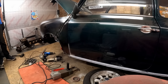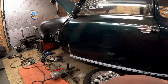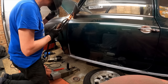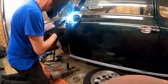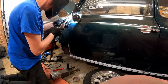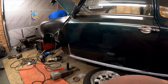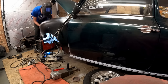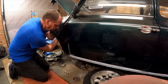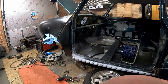Now the top of the A panel is seam welded, so I need to get the MIG welder out. I did struggle a little bit up there — the metal's not fantastic, a little bit of corrosion, and I did blow through in a couple of places. Now I'm just welding under the bonnet where I've spot welded through on that front panel. Sometimes when you spot weld for too long the spot welder — which has a timer on it — actually burns through the metal, so I'm just filling up the holes there.